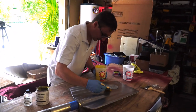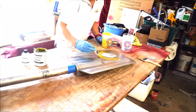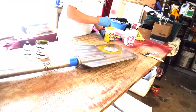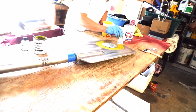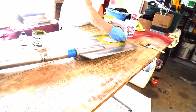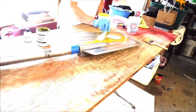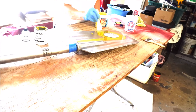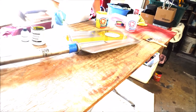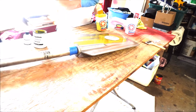What I'm going to do is I'm not going to paint my zinc — I'm going to go around it very lightly. You can use a foam roller, but obviously you can't use a foam roller if you're going around your zinc, so you've got to use your brush. This stuff has a working time of eight hours, and it has to be applied in at least above 70-degree weather so that it will dry properly. So there it is around the zinc. Now I'm going to go ahead and apply it up and down on the rudder in an even coat. Remember, you're applying this straight to the bare metal. If you've stripped it already down, this is what you're applying to have an anti-fouling agent on your rudders or any part of your running gear.